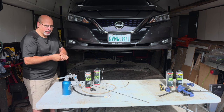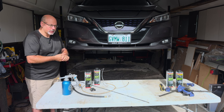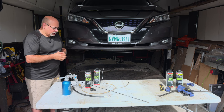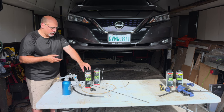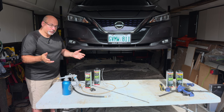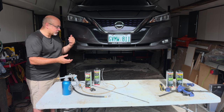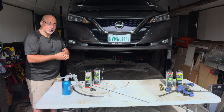It has active ingredients that react with rust. You can look up their MSDS and see various ingredients that are part of their patent that actually react with rust. The 701 Classic Car 3-year test — I've used a lot of different products. I've tried Crown, Rust Check, Mike Sanders Grease, which is a product you have to heat up. I actually have a wok with a drain in it to heat this wax to 80 degrees — real pain.